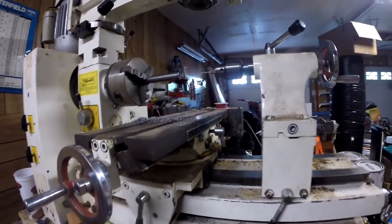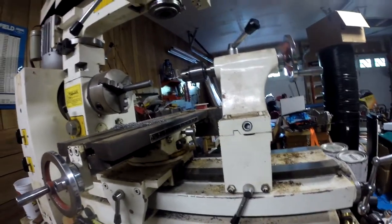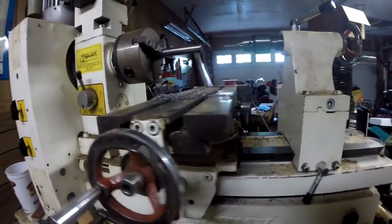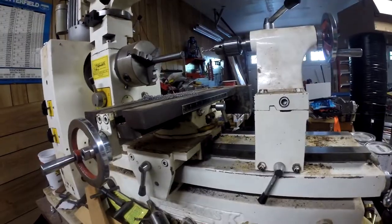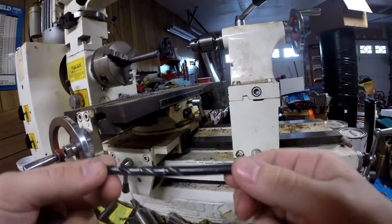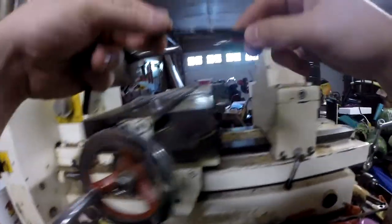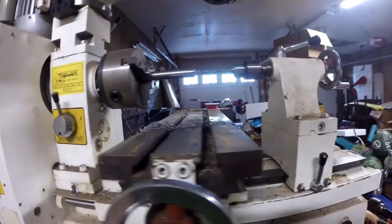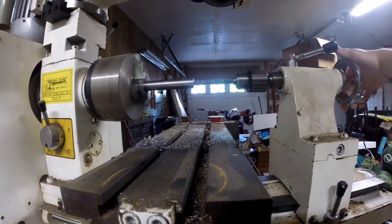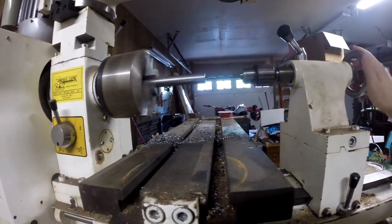This one's going to be very hot, by the way. My dad just told me — you don't actually have to use a smaller drill bit first. I think I must have gotten that from drilling by hand, because when you do that, you definitely do, otherwise you just can't hold onto it and it'll get stuck. But anyway, we got the hole drilled about as deep as I want it to go. The drill bit I picked up for the next size up is actually 17/64ths, and it just happened to be the one I pulled out. So that's great — put that in there and we start drilling.